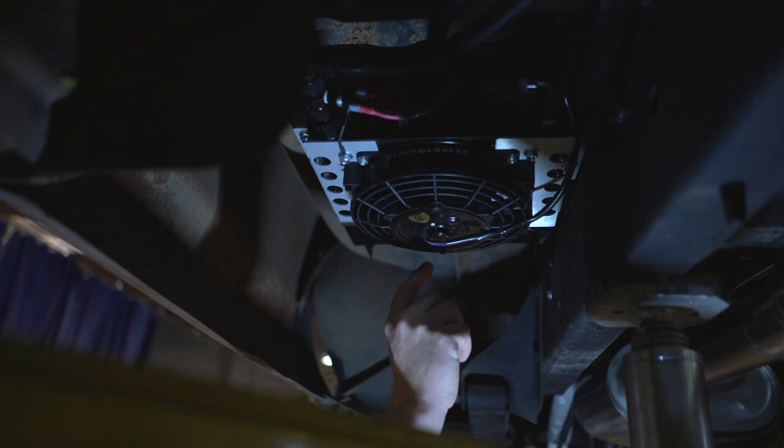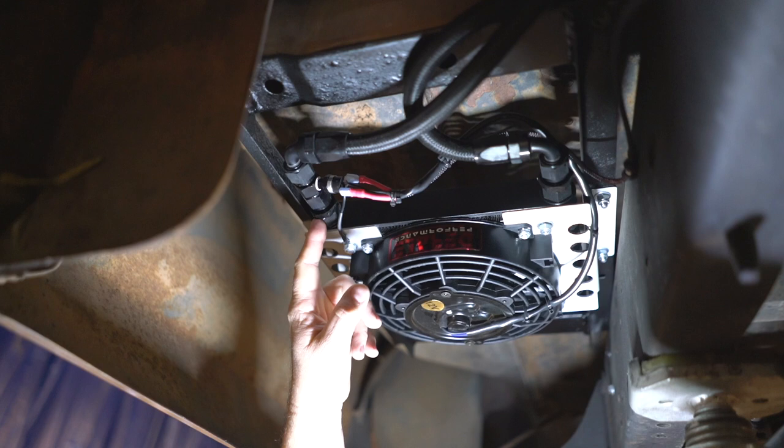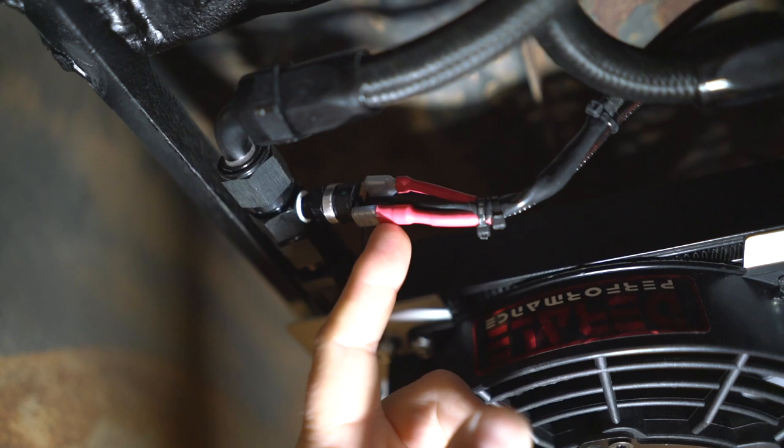I'm going to show you one we have installed so you can see how we plumbed it, how we have a thermostat sensor in there, and how it works. Follow me over to this truck. We'll climb under here. We've got one tucked in here underneath this truck, with a 12 volt supply, just a nice little system. I don't know if you can see it, but we're a -8 on this system, so it's pushing some fluid through there. We've got this little fitting here with a thermostat sensor, and that sensor triggers the fan to come on at that temperature. Once it gets to 180 degrees, that relay opens up and allows it to turn the fan on, which also allows it to turn off when it's not that hot.